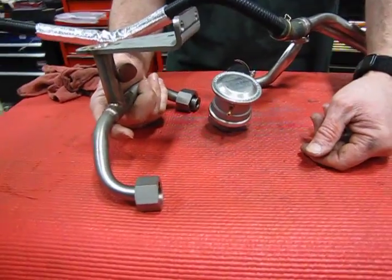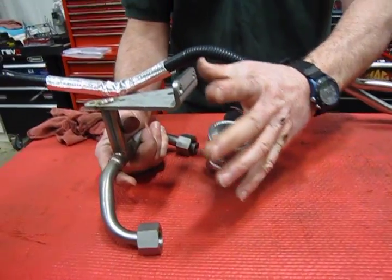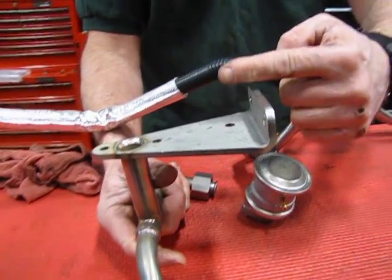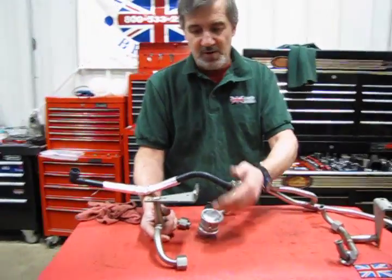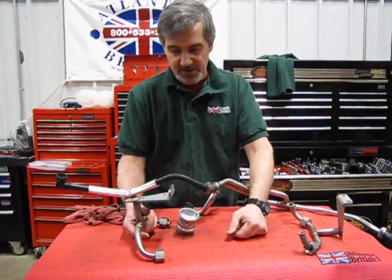These bottom nuts on the original design, especially if it's been there for a while, can freeze in place pretty well. So normally what I do is, instead of trying to remove these and take the whole assembly out, you can actually take a small stud puller, because that's what's going to be in the manifold. They're not going to be bolted, they're going to be studs. And you can remove the studs, which will free up the connection here, and we'll be able to lift the intake manifold away from these without unbolting them from the exhaust manifold. Makes life a lot easier.